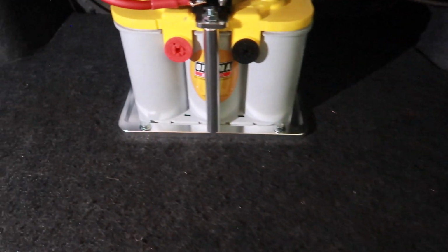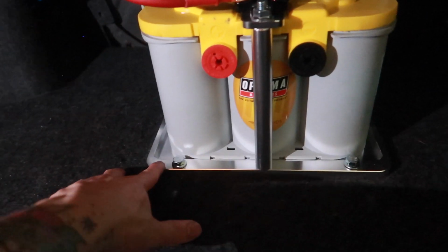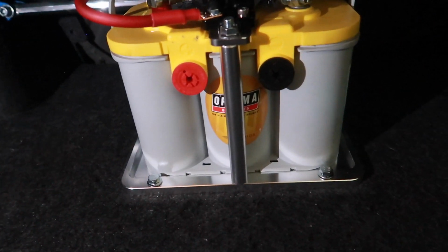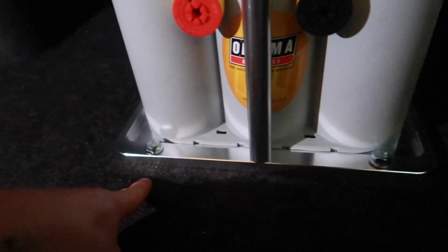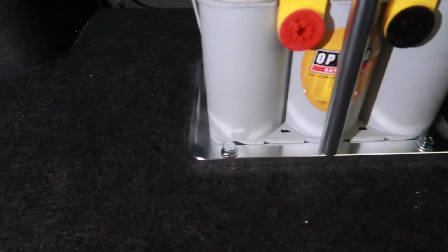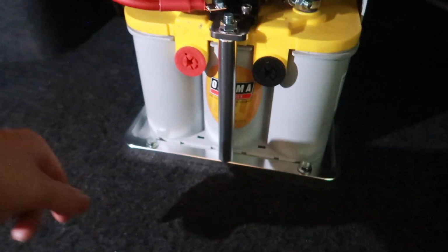Then I went ahead and drilled in some pilot holes for the aluminum bracket for the battery into the wood, installed 4 threaded M8 rivnuts, then went to the hardware store, got 4 extra long bolts to accommodate for the bracket and the wood, with some locking washers and nuts at the end for added stability. Like, this thing definitely isn't going anywhere.